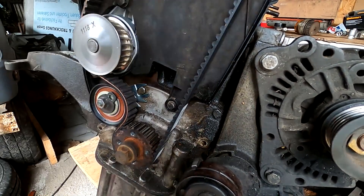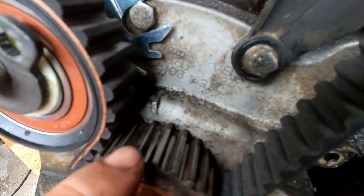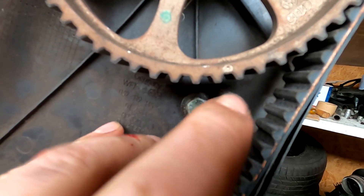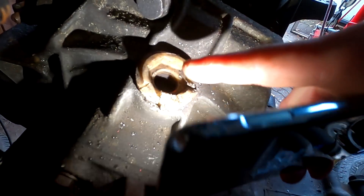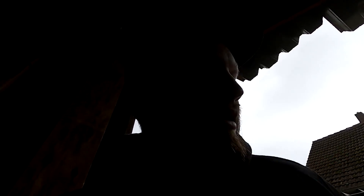Good, now we're back at TDC, on the markings. Here you can see it on a small notch that must align with this line, and up here with the dot and this marking. Of course the TDC position at the flywheel must also be correct — there's a notch on the flywheel. So that works. But the tensioner pulley is moving with it — I'm not sure if that's supposed to happen, so I'll check the manual carefully. If everything checks out, the engine goes straight into the Golf.